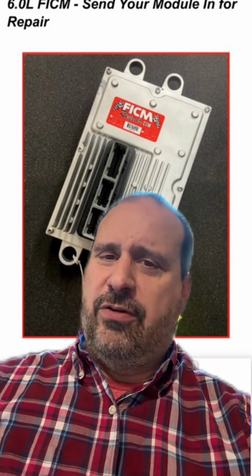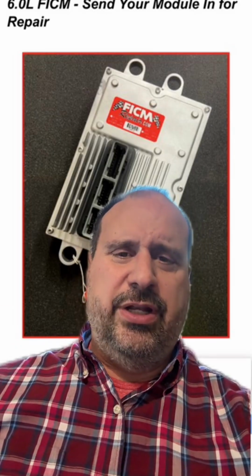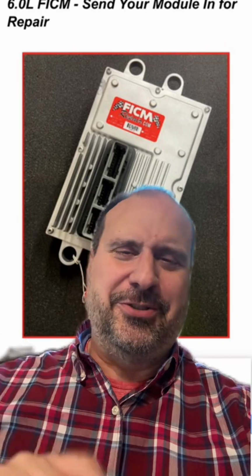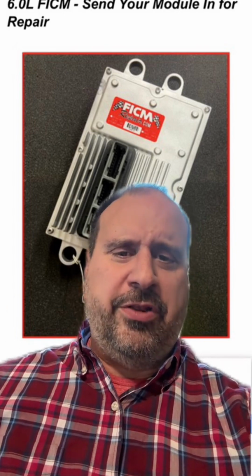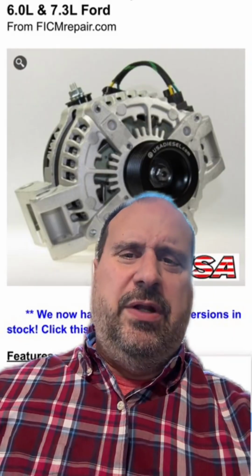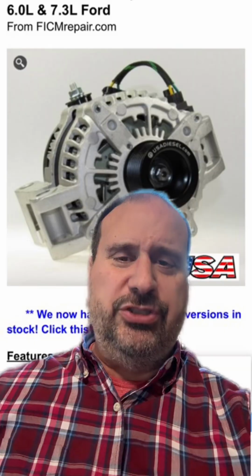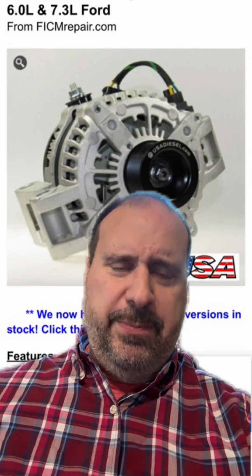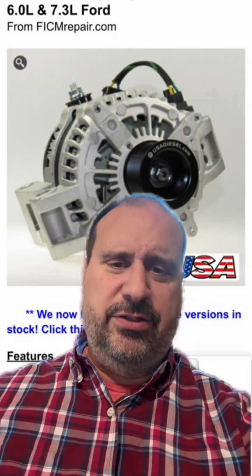So maybe you saw the other video that's uploaded right next to this one of the install of a customer with an Excursion. I called it, if it was an automatic. Oh my god. Obviously it's an Excursion, it's an automatic in that other video. But he installed a 240 amp alternator that did 190 at cold idle. Yeah, we're talking about this bad boy right here. And if you had that alternator, probably you wouldn't have subjected your FICM to inadequate supply side voltage, and probably you wouldn't be in this predicament. So I hope this helps somebody. And recognize it just doesn't have to be this way. You can rely on your truck.